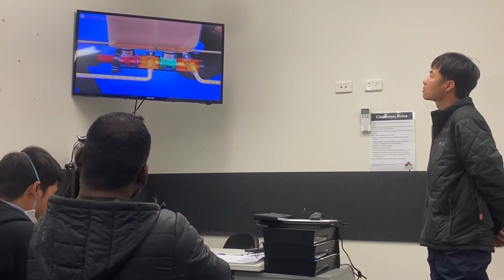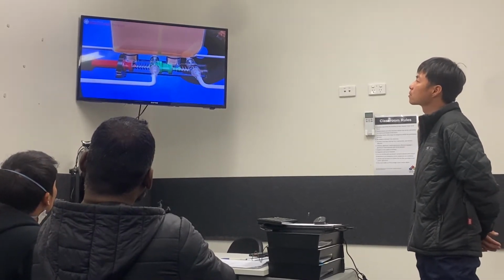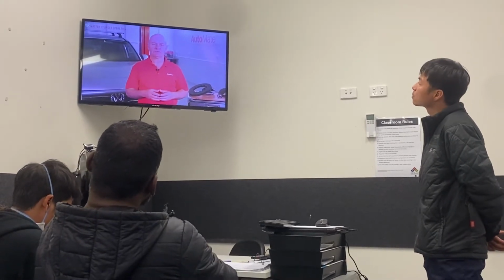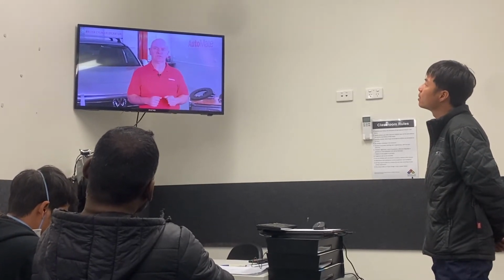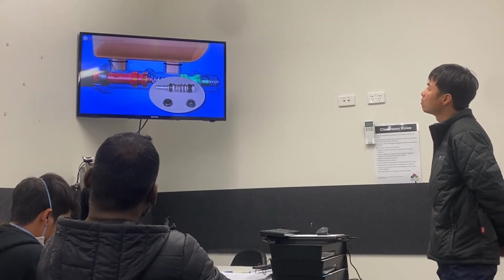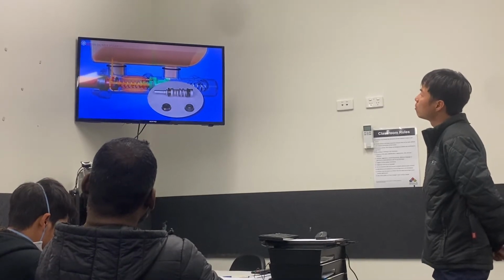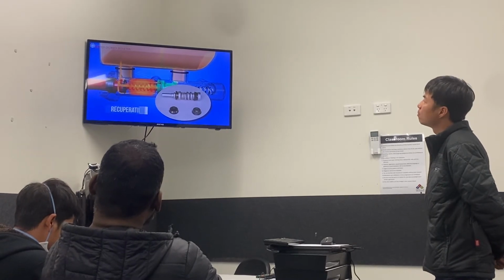When the driver releases the brake pedal, the return spring moves the pistons back to their stationary position. As the primary seal uncovers the compensating ports, fluid returns to the reservoir. Often when the pedal is released quickly, a low pressure is created in front of the piston, so that momentarily the pressure in the reservoir is higher than the pressure in the cylinder. Small holes in the pistons and grooves formed in the seal allow flow from the reservoir through the inlet port and past the primary seals into the pressure chamber. This keeps the pressure chamber full of fluid at all times. This process is called recuperating.